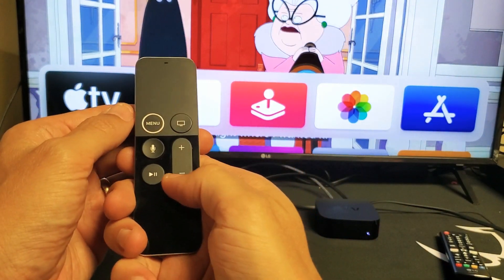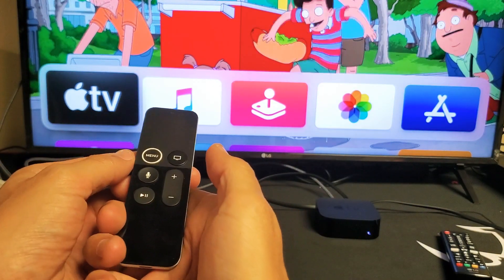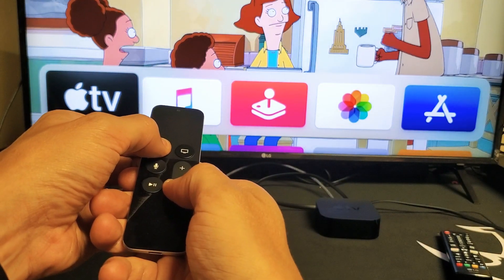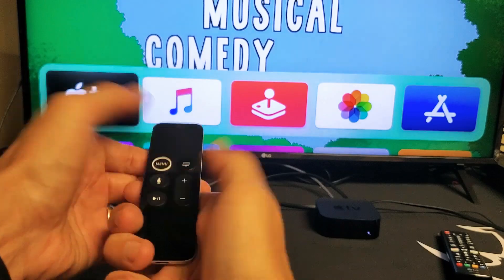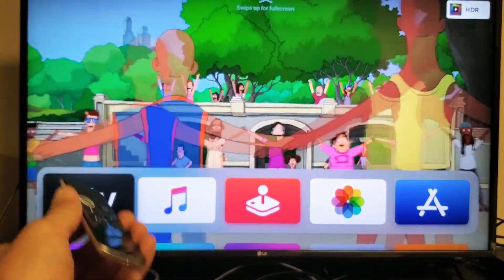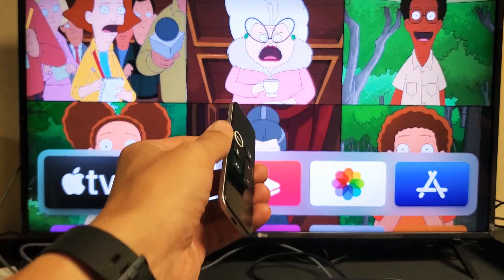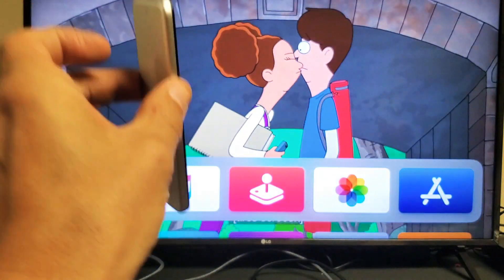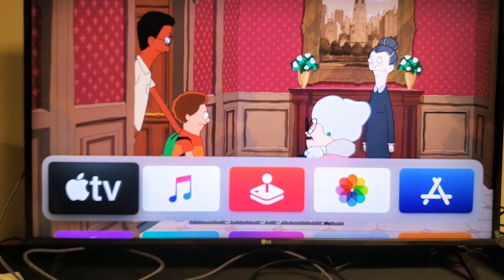Menu button and Volume Down — press and hold for about 10 seconds, then let go. My screen turned black and it just turned back on. You may get a screen with an Apple logo and a message saying to click OK if you can see it. From here, open up Amazon Prime and hopefully you guys are up and running. If not, we're going to the next step.